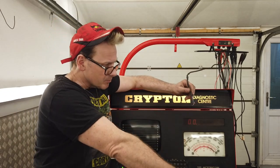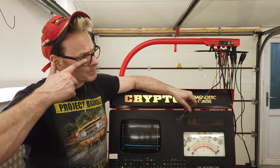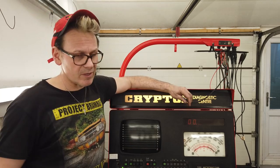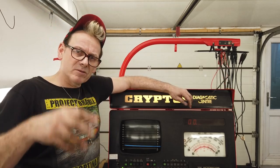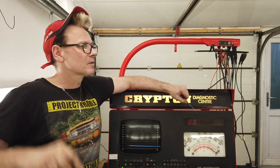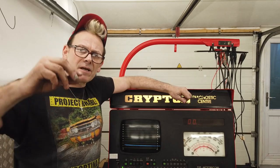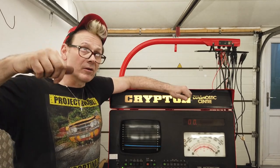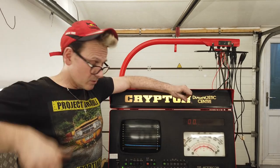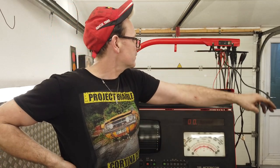So the Cortina plug would be for the Cortina coils, the Lucas, not Lucas, Bosch, no? Well, many people made the coils, to be fair, but large pillar and small pillar type coil. Some have spades on, some are the same size pillars, some, you know, Lucars. But on Cortina, it's a slightly wider diameter on the B plus connector, and then the CB connector, I think, is the smaller diameter. So that needs sorting, because that's an important thing to be checking.